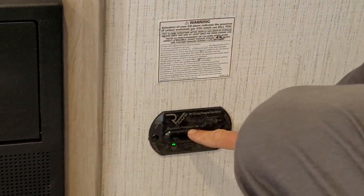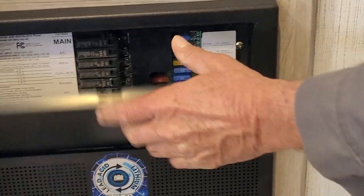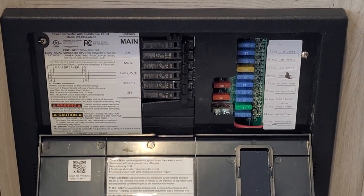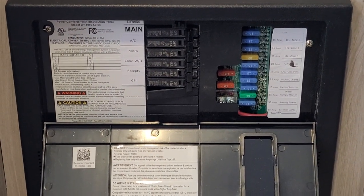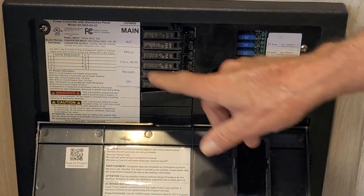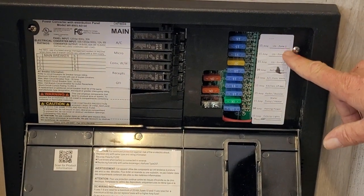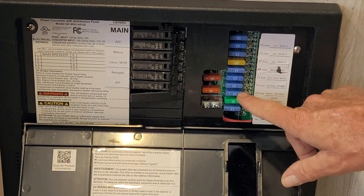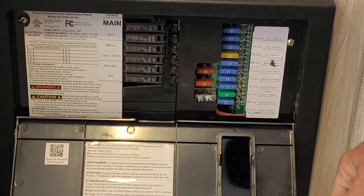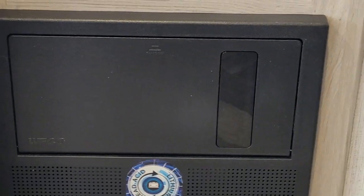It does have an LP and carbon monoxide detector in the trailer. It gives you one long beep when it smells LP, and two beeps four times in a row when it smells carbon monoxide. The breaker box is marked with your top 30-amp main at the top as they come down, and they are marked on the side. Car fuses on the right-hand side are marked from the top coming down — when one blows, there is a red light on the right-hand side, and you can also see through the tinted lens on the cover.